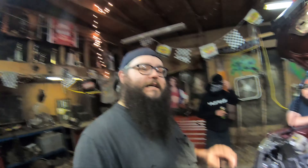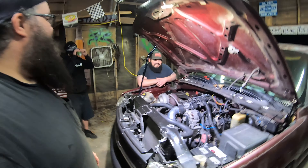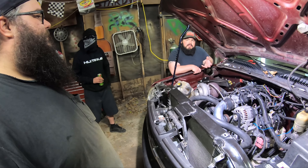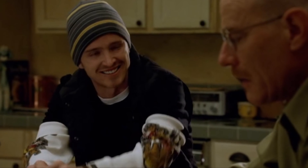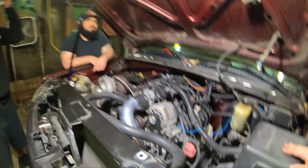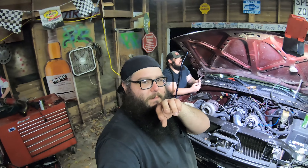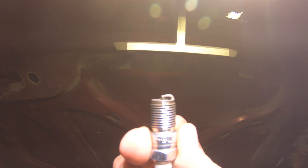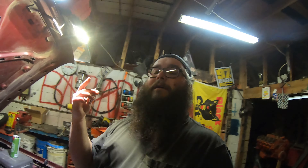Me and Walter were talking about this — a lot of people complain when you open these engines up and let the magic out. You have to strategically put it back in by honing all the cylinders, forgetting to clean them out, and leaving iron dust debris in the engine when you run it. We just found some stuff — we noticed that when looking at the plug, there's one dead hole.